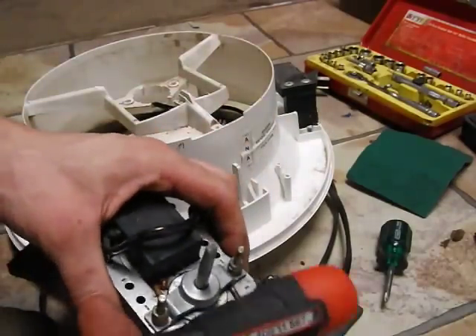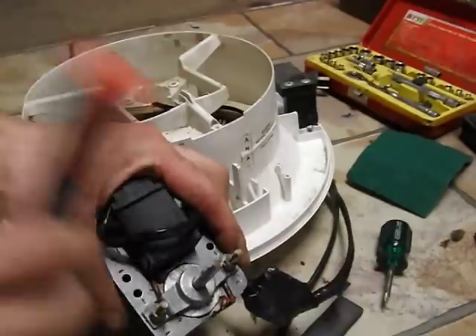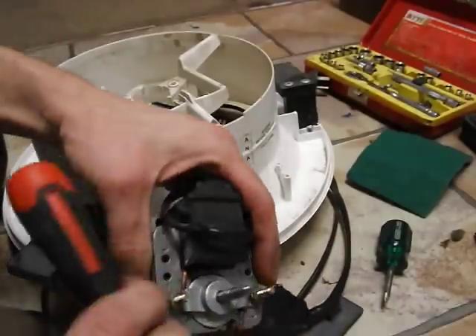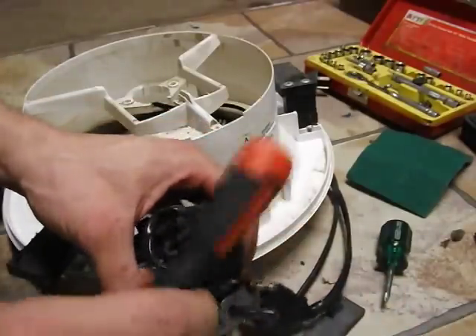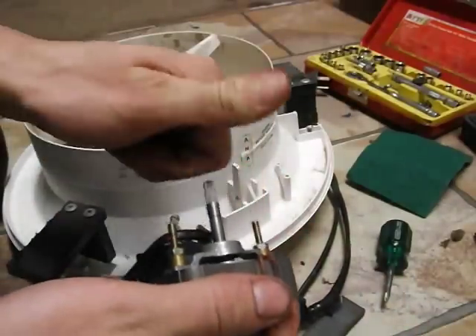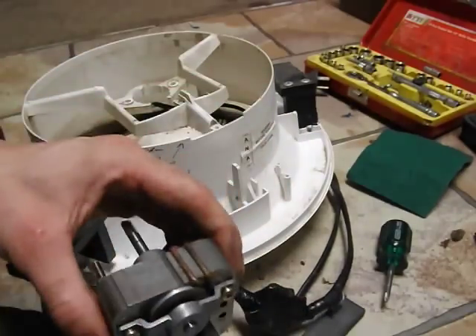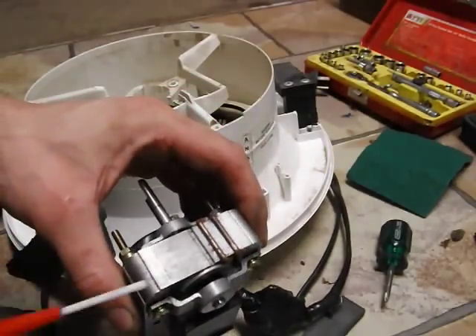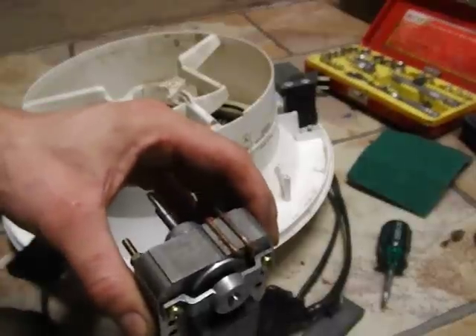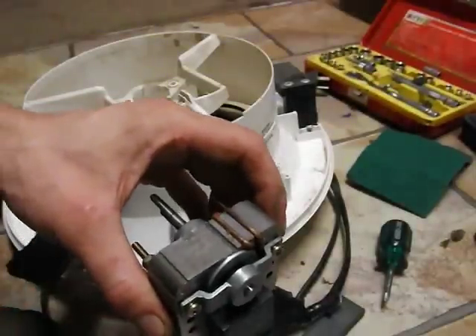Sometimes what you've got to do is very gently - not with a hammer and not with a piece of steel - just give it a tap side to side, very gently. That'll help center the bushes up. I'm going to dab a bit of lubricant in where the bush meets the nylon shims.